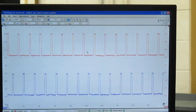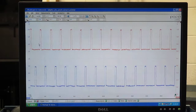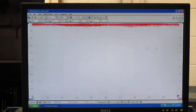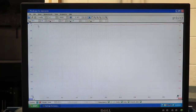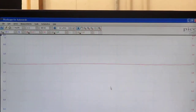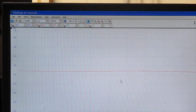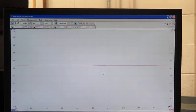I've opened up Pico. There's the so-called example of what the signal should look like. Mine won't look quite that good because I'm going to spin the wheel by hand — if I were to run the car it would probably look that way. I'm going to turn filtering on; that'll be a whole lot better. I'll change the voltage to 10 so you can see the signal better. I'm stepping over to spin the wheel. I'm spinning the wheel by hand, so that's not very effective, but at least I know there's a signal coming out. The real test is probably to run the car and spin the wheel. So that's digital sensors.